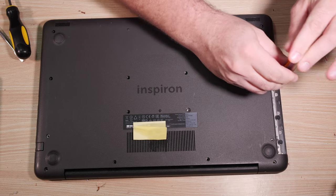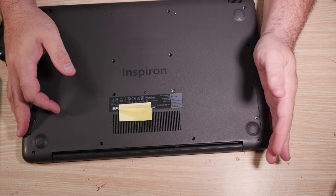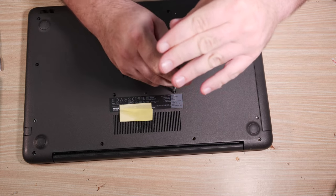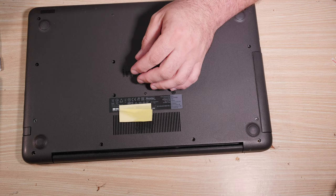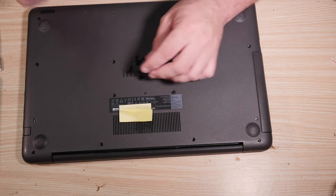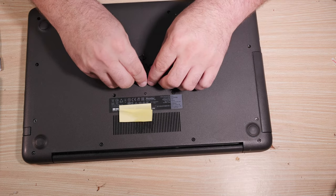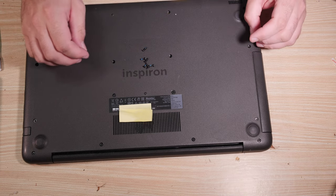Okay. Once the three flat screws are in place, put your optical drive back into its bay and put your small optical drive retainer screw back through the back here. And now it's just a matter of putting all these screws back in the case. And boy, are there enough of them or what? Man, oh man. Okay. So all these screws are going to go back in the case. And frankly, at this point, you probably are better off just shoving them all back in the holes and then screwing them down. There is one more thin one, actually.